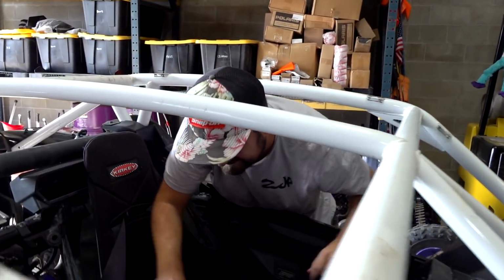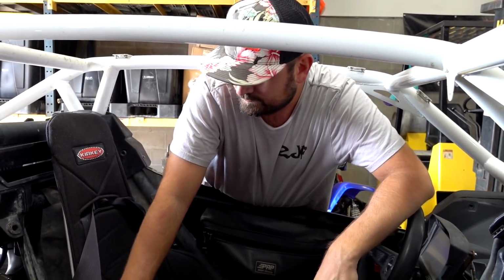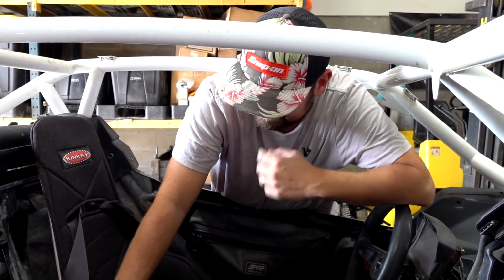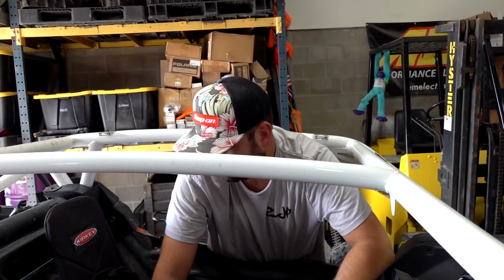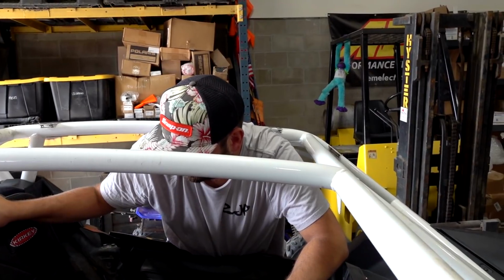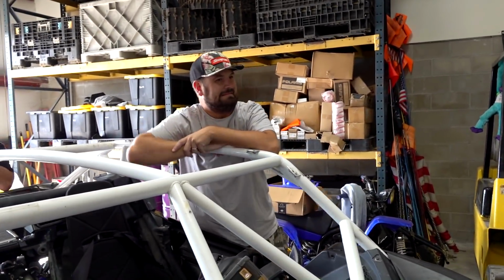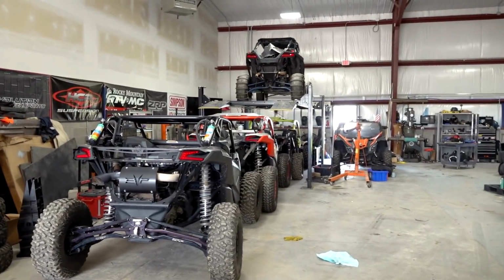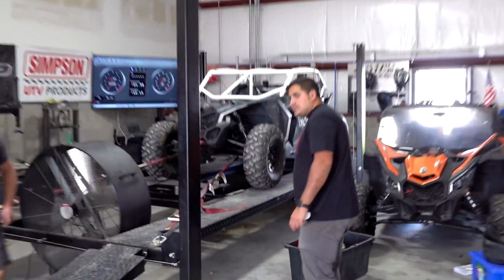I'm going to pull a log somewhere else as well. Taco Bell. All right, are we going to continue to field test this thing, or are we going to put it on the dyno? Sure, that's a good spot for doing some test and tune. We can adjust crack pressure right on the dyno, huh? Yeah, see what she does. Maybe we'll just see what it makes on 41. Maybe we make a base pull, and then we start cranking it up. Turn the actuator up, double check all our lines, make sure we ain't got any boost leaks, make some power. We got a lot of stuff to move. There's a lot of crap in here. All right. Beast mode's on the dyno.